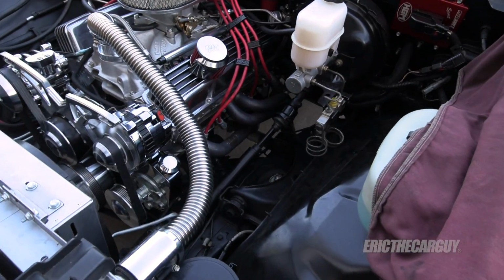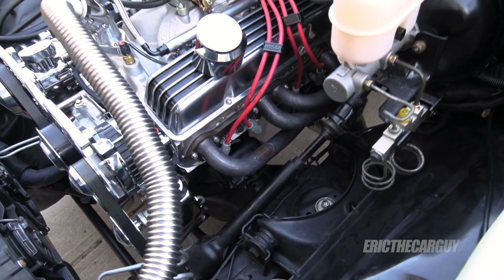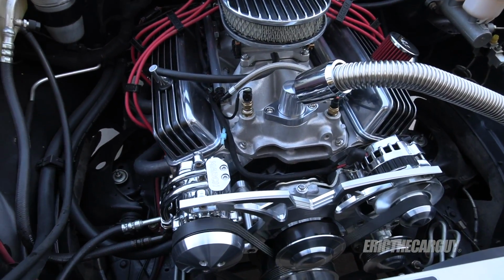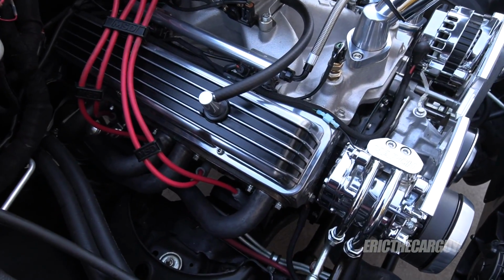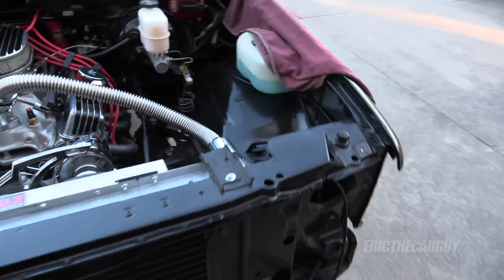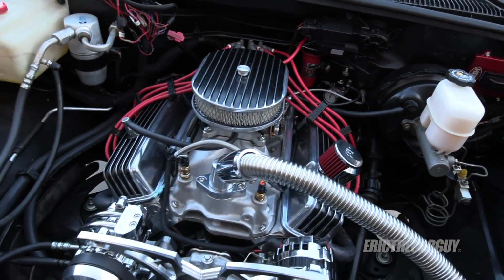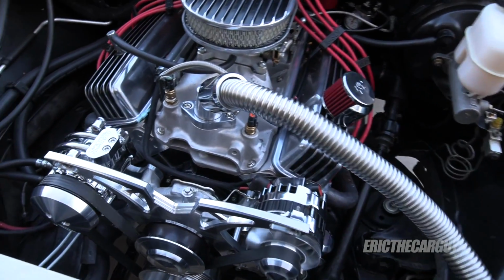Sounds good. A couple of small exhaust leaks. I used gaskets instead of RTV this time because I trued up the manifold. Just gonna let it warm up the temperature. Sounds a little louder on this side. Maybe not. I think I need to raise fuel pressure a little bit. But otherwise, it's live.